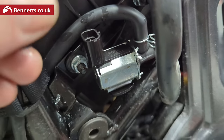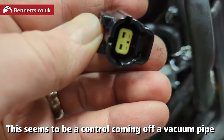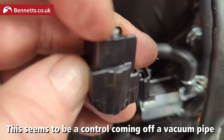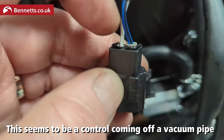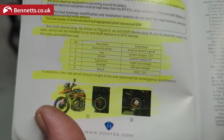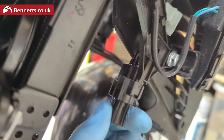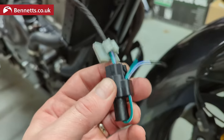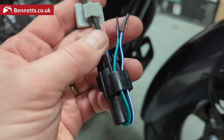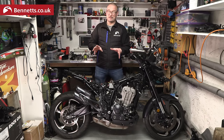Something I just noticed — the plug isn't properly sealed and looking inside there does seem to be moisture in there. More irritating than a real problem is the accessory connector. The instructions say it's on the left of the bike but it's actually on the inside of the right hand panel. Still, you can get to it without stripping the bike, the tails are sealed and were taped out of the way, and it is a waterproof connector — this is where I'll power the accessories from.